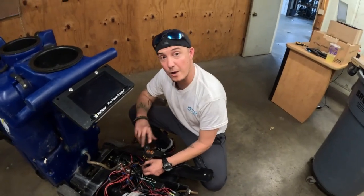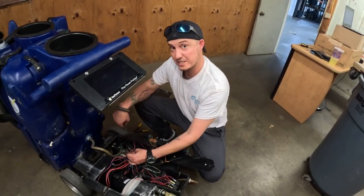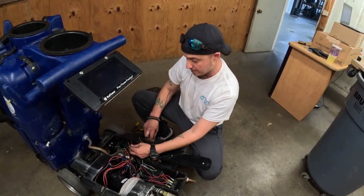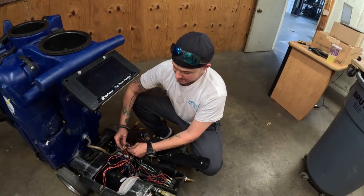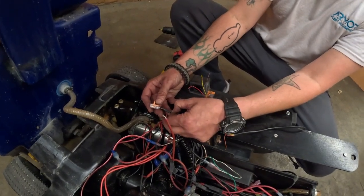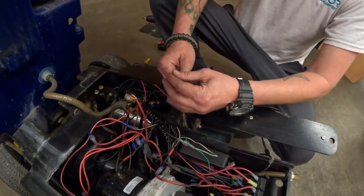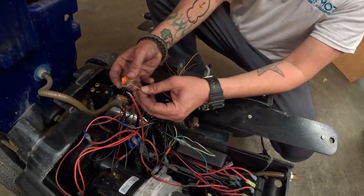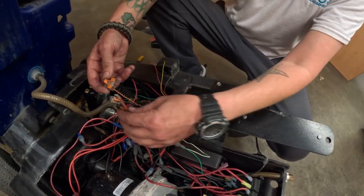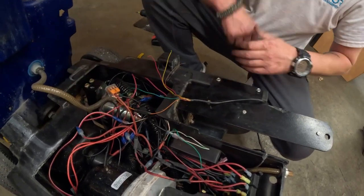Okay, now we're going to establish power to your Armor 4 device using the 36-volt wires that were going into your step down that we took out. What we're going to do is hook up your ground wire to the black wire and your 3-way Wago. Now use the green, which is ground in this harness, but it could be black in our other harness, to the 3-way Wago. Now let's do the positive side. Same thing. Put your orange wire or the wire with the fuse, which could be red as well, and add those to your 3-way Wago just like that.